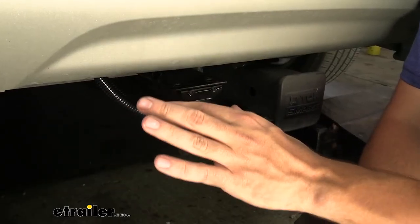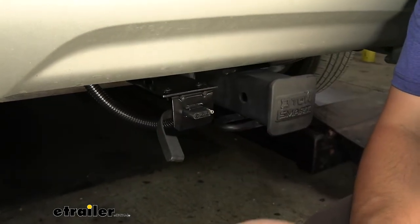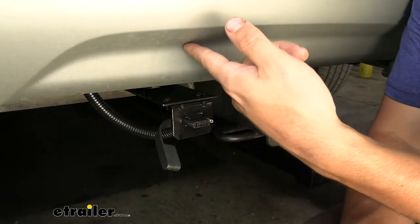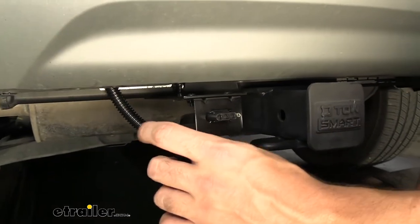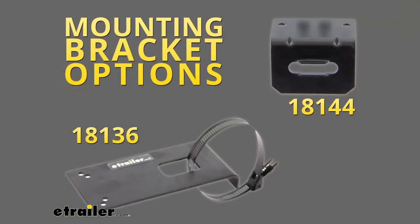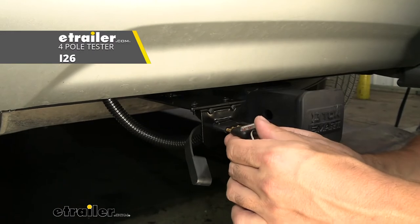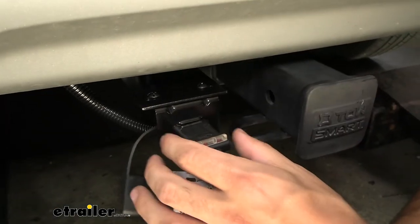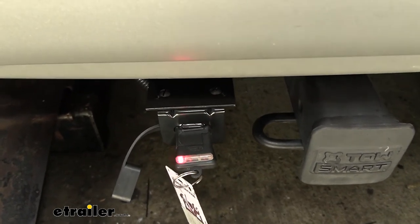Before we do our testing, you can see we have our trailer connector mounted. If you chose to route it outside the vehicle, go over behind the bumper once through the grommet, and you can either secure it to the safety chain loops on the trailer hitch with the included dust cap, or you can purchase a combo bracket available at eTrailer for a cleaner install look. Now we're going to go ahead and plug in our four-pole tester. If you don't have one of these, you can just use your trailer — keep in mind if there are any issues on the trailer, they will carry over to our testing. Let's jump inside and run through our signals.